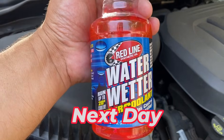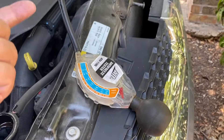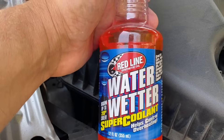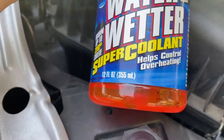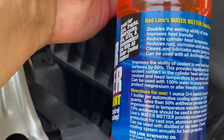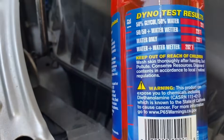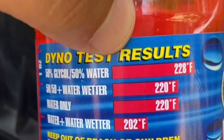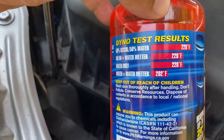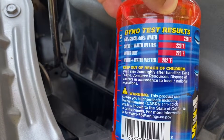The next day I let the vehicle cool off. I went ahead and took some coolant from the radiator out, put it in the coolant reservoir using one of these devices — you could probably use a turkey baster. Water Wetter has some pretty slick advertising: it's called Super Coolant, claims to cool off your vehicle by 20 degrees. The chart claims that using water wetter with a 50-50 mix will lower the temperature from 228 to 220.